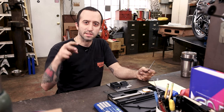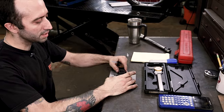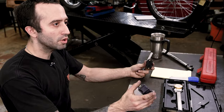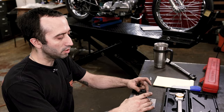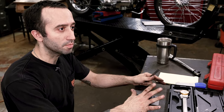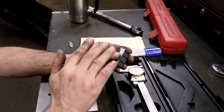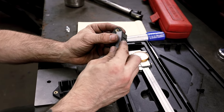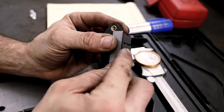It's also steel so I've got to get some paint on it — you could also chrome it, but since it's in the back I'm just going to paint this black. We're going to mount our circuit breakers on this. As you can see I have the plate actually flipped over because I want to do my layout on this side — I also have to put the counter-sinks in, so I don't want to drill from one side and have to flip it over. You can honestly probably lay this on here and mark your holes just with a sharpie and then drill them and bolt them up, and that'll be fine. But I want to show you another way of how to lay out your holes so that when you actually take the time and drill it nicely, you'll be confident that this thing's going to bolt up super nice.